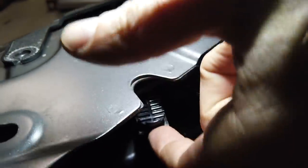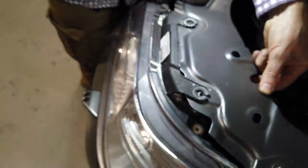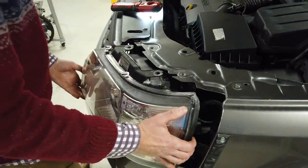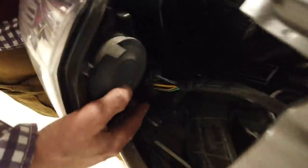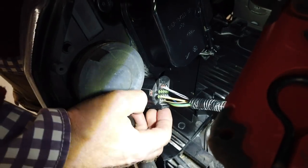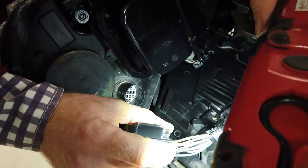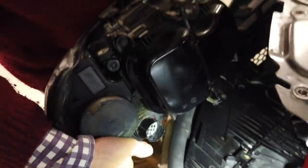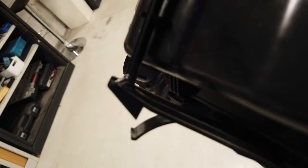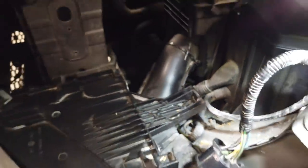In the back, there's a little cut-out at the top. Pull this up and it lifts a little bit, then the headlight just slides out on this tricky little dock system. Be careful as you wrestle it out. Then you've got the connector - press in that little tab to release it. There's also a little rod that releases a clamp at the bottom, freeing the headlight from its grippage. That's the headlight out. We'll do the same on the other side.